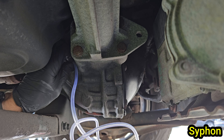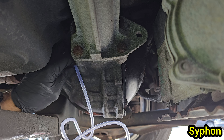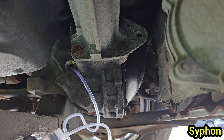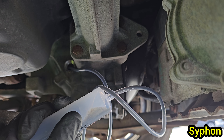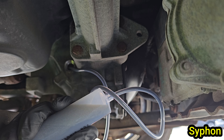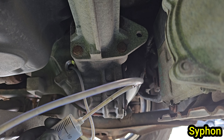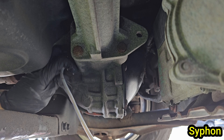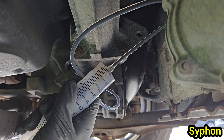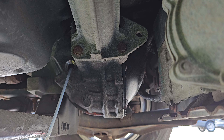The goal is to stick the tube as far into the diff as possible and then start siphoning fluid out. If nothing comes out, go ahead and move the tube around as it may not be reaching the fluid like you need it to. I have a 500 milliliter siphon linked in the description below which makes it a lot easier to extract. Keep doing this until you remove about two quarts. If at any point you are no longer extracting fluid, move the tube around because it may be curled up inside the diff and not resting at the bottom. Once nothing else is coming out and you've removed close to two quarts, you can remove the tube and get ready to fill the diff.